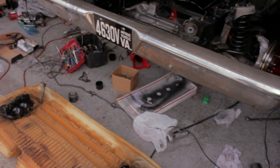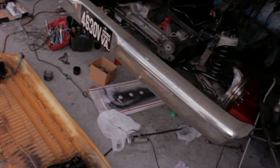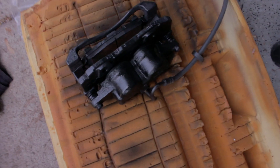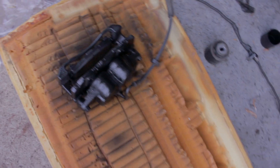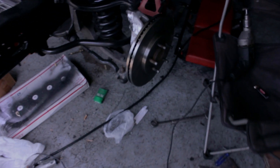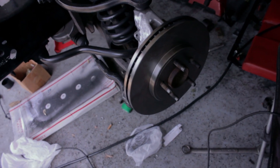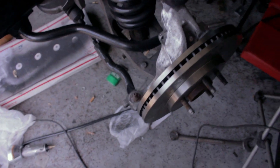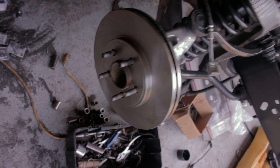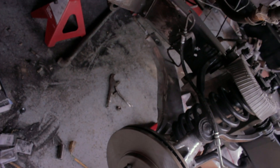I haven't felt like keeping up with the camera. So today's progress: calipers are pulled off and painted. I used header paint because it's rated up to around 1500 degrees — caliper paint is something similar, needs to withstand high temperatures. Putting the new brake rotors on, nice and shiny and new. Cleaning up the area back there so we can mount the trailing arms later today. There are brand new brakes all around and it looks real sharp.